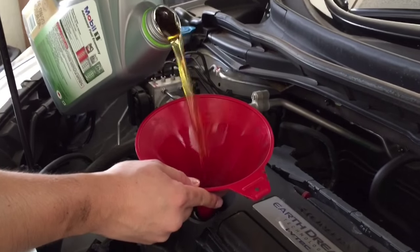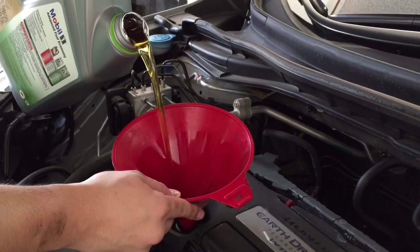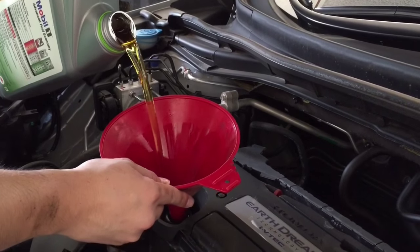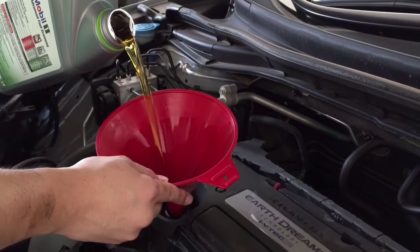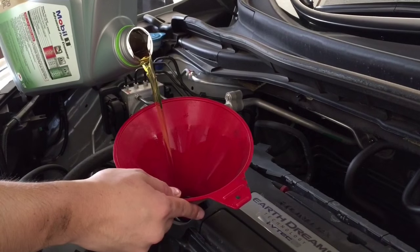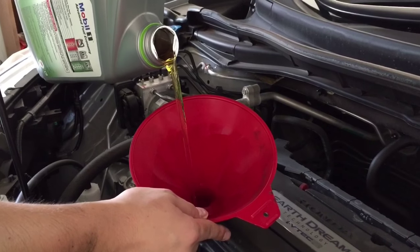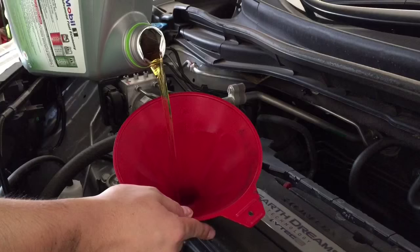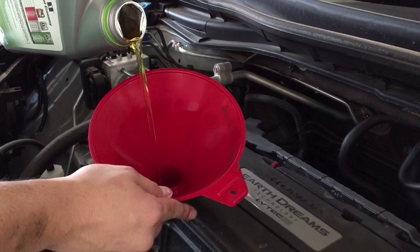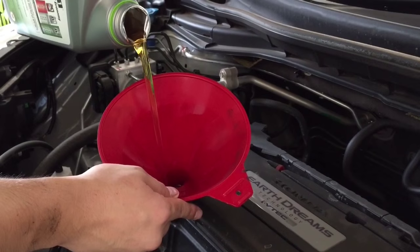When you're pouring the oil in, make sure you have a pretty clean funnel. It kind of depends on how much your oil has been consuming, but I usually start off with four quarts. I think the engine takes 4.2 to 4.5 quarts depending on how much oil you burn or how much you left in. Just check your dipstick — it's below here and it's going to be in the orange. Once you fill it up, put your cap back on. Make sure your oil filter is on tight, recheck your drain plug, and make sure you have everything reinstalled correctly. I'll link a video on how to turn off the maintenance minder next.